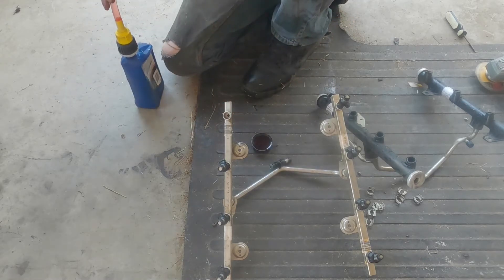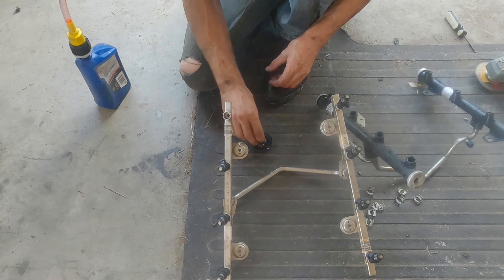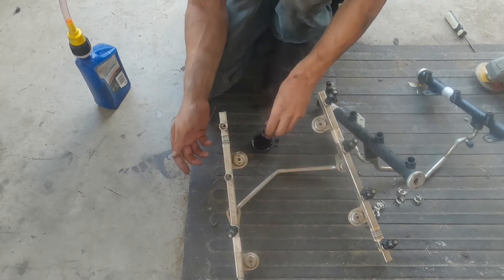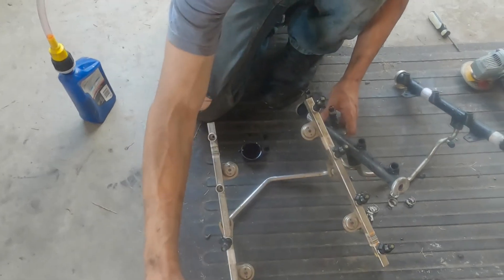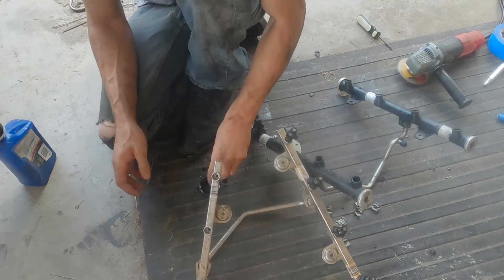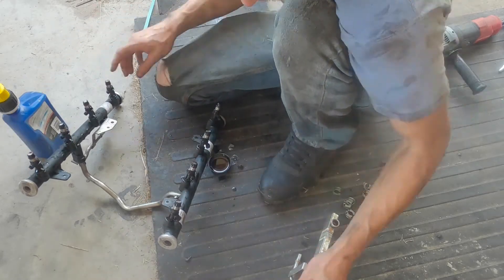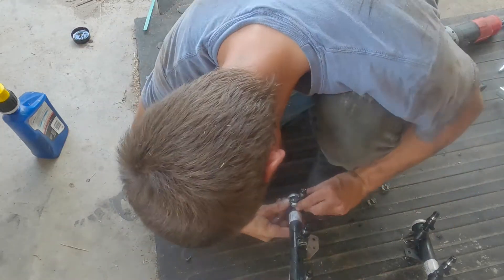Using the oil cap, I just dip each injector to get some oil on the O-rings. Then it pops right in. I'm going to go ahead and run through these quickly and get all the injectors swapped over.